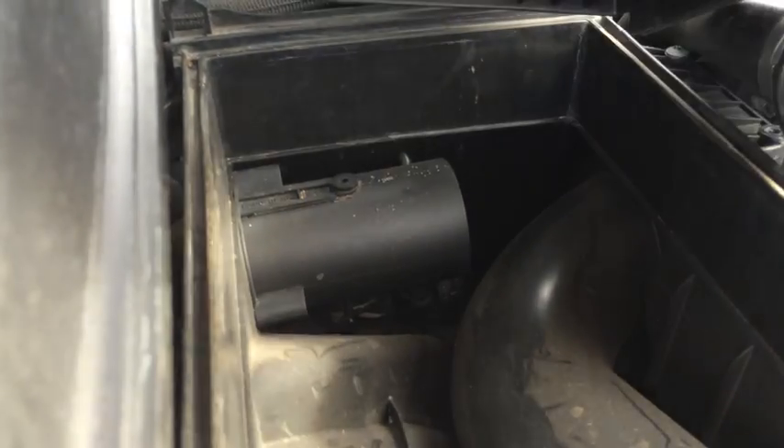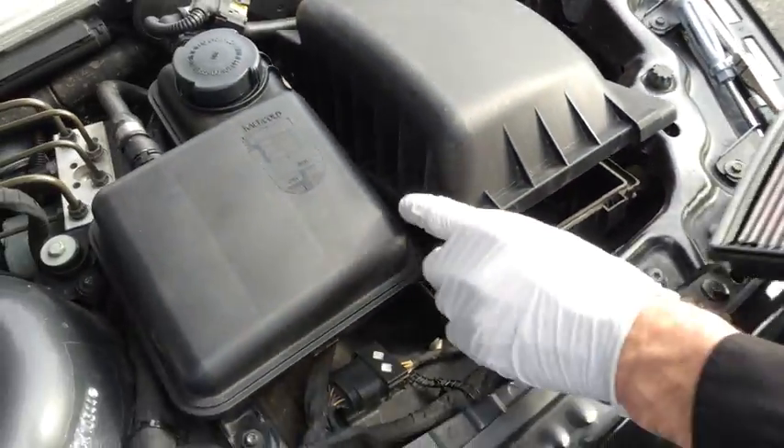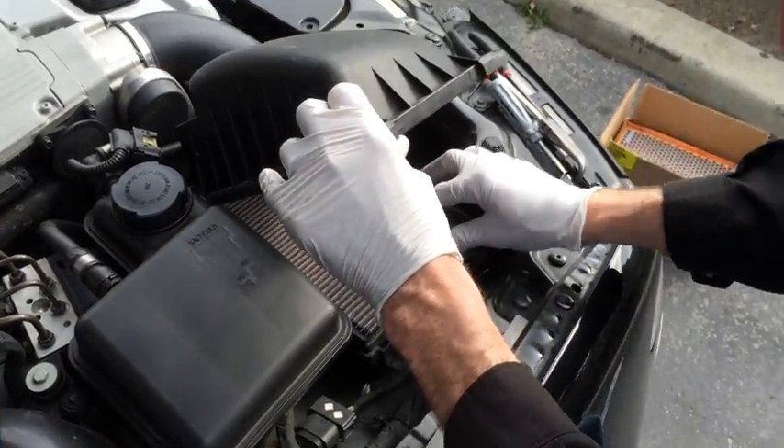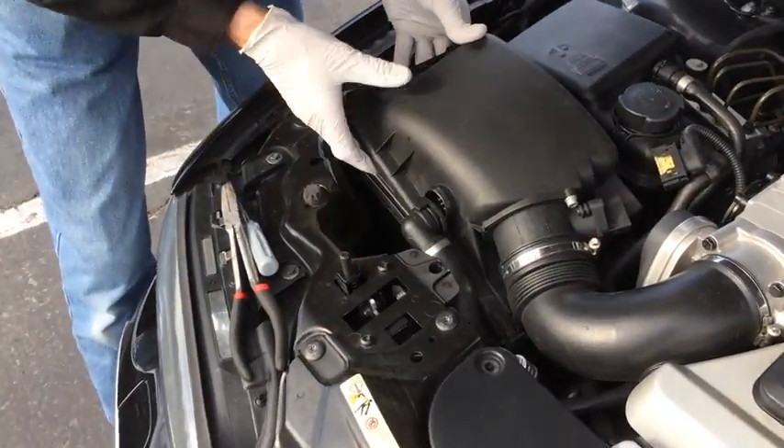That's the trumpet that goes forward? It's not the same size as the throttle body. Here is the auxiliary air valve — or whatever it's called — which points at you and gives you sound. It's got a little vacuum-actuated valve on it that's controlled by a solenoid.